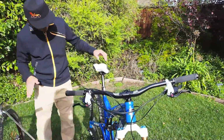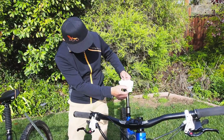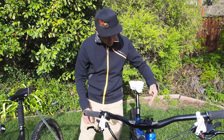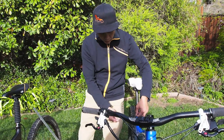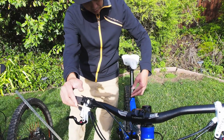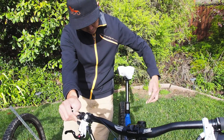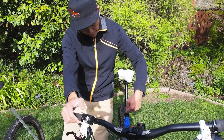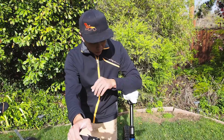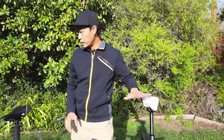And finally, 1 bolt on the Chronolog. So a little bit harder to keep the saddle adjusted and in place. And reliability, there's been some issues. Basically, when this cable is not perfectly adjusted and does not allow that little movement that you see here, the plate that grabs the seat post will eat away at it, and the thing will start slipping. So when you sit on it, it'll drop about 2 to 3 millimeters or a little more. So a little bit of reliability issues on here.